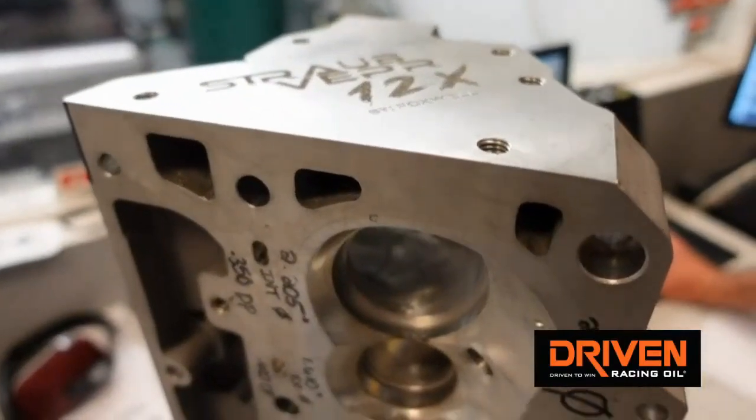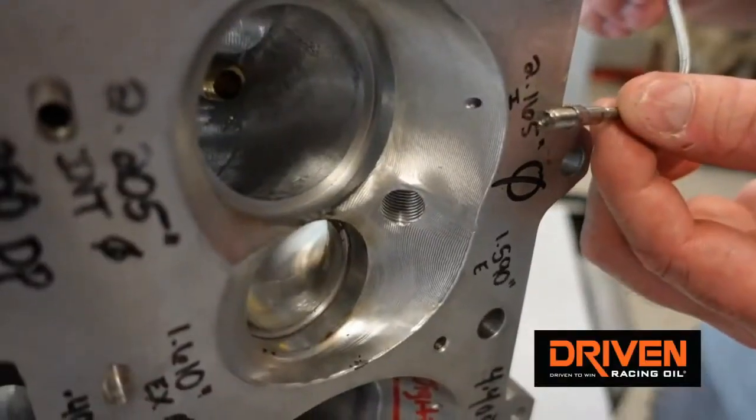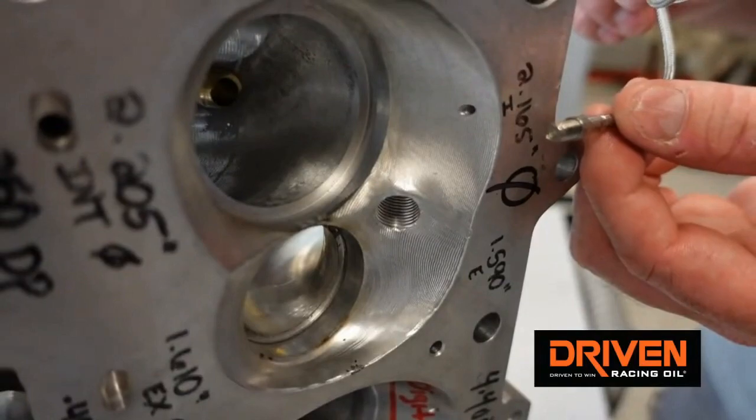To use this appropriately, you've actually got to drill into the cylinder head. So I called our buddy Chris Straub and said, hey, do you have any heads that maybe you screwed up? I need one more. And of course he's like, what'd you break? I said I didn't break it, but I want to. He sent us a blem casting and I took it in the mill and started probing where we could drill through the deck, the thick part of the cylinder head below the water jacket. Good thing we used a practice one because I actually penetrated the water jacket in a couple areas. But ultimately we found where we could drill into the head and drilled, tapped, and screwed in this little combustion sensor in all eight cylinders.